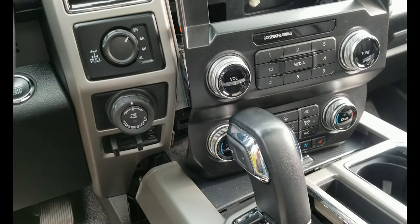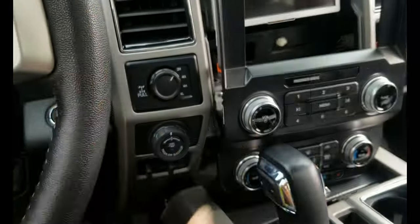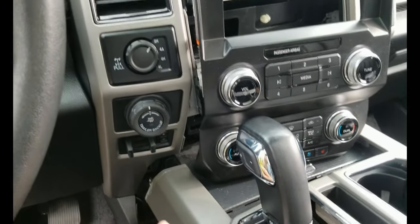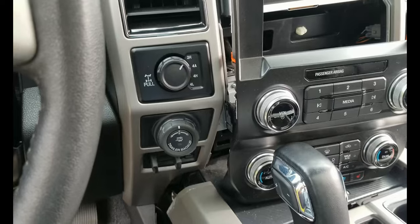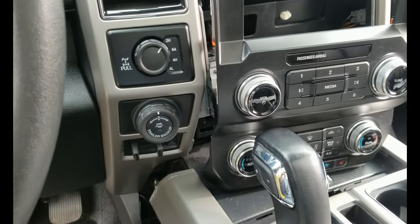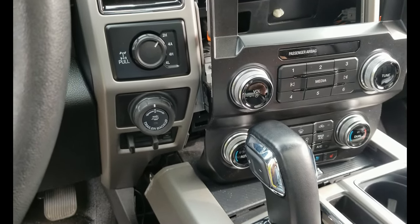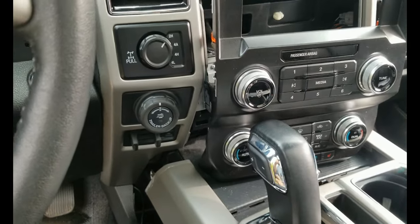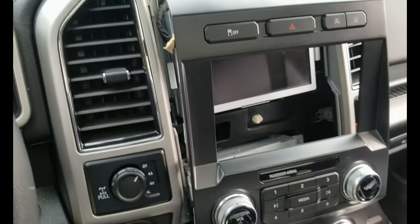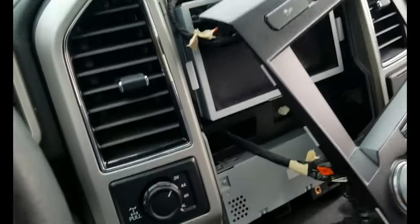So that issue, I already know it: while you're hauling your trailer, it keeps saying on your screen that the trailer is disconnected. It's not the brake controller issue, it's the 7-pin connector at the back. Some people put a tie wrap or whatever to secure that connector, which I'm gonna do when I get a new trailer, because I sold my old one. I'm gonna buy a bit bigger one, because I have 3 kids with a bunk bed. Yeah, so I'll see.